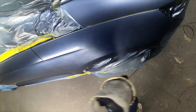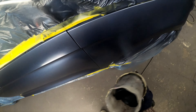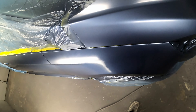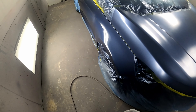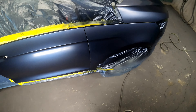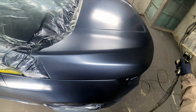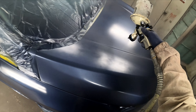Second coat — as you can see, covers that nice. Make sure you're doing that blend. I kept the blend small on this one; usually I go about halfway up the door to give me some room for a nicer blend. Sometimes I take the base coat blender and base coat mixed 50-50 to thin out the base coat and do a blend if I'm having trouble with a hard silver or gold, but this color you don't really have to worry about it too much.